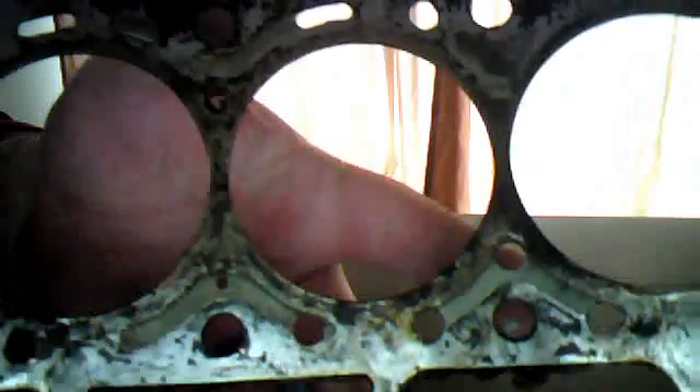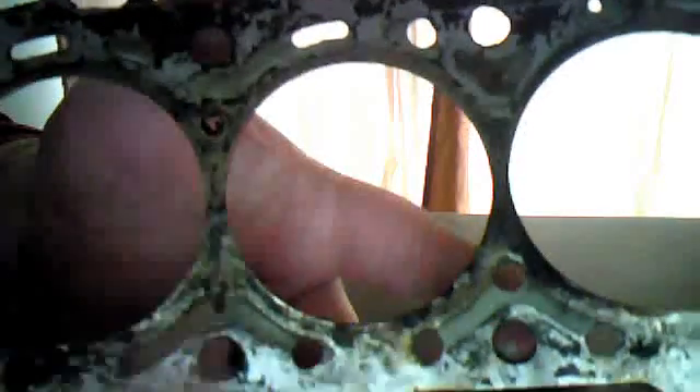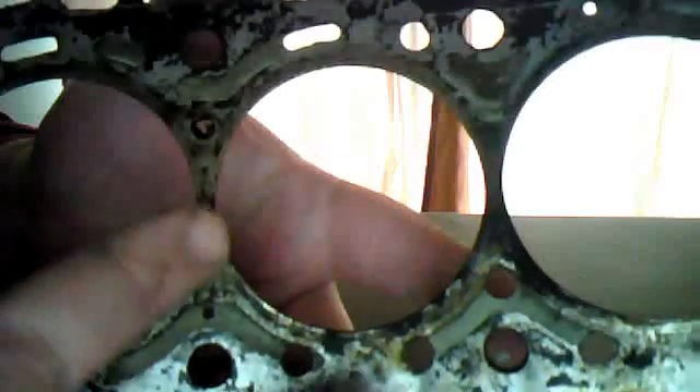The combustion, when the head gasket and block are compressed, is to stay within the fire ring. And if you compare between these two cylinders here, these two fire rings, it does look worn, but that's just from being on a vehicle since 1984 — this is the original head gasket. But if we look here, we have carbon buildup and deposits. I can wipe it off. I can tell there have been combustion gases and pressure leaking out of the fire rings on both sides of these cylinders.